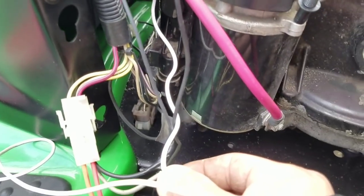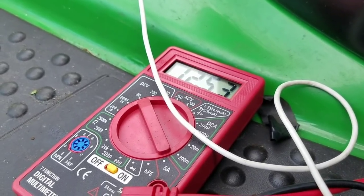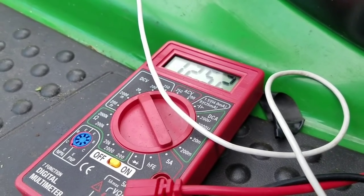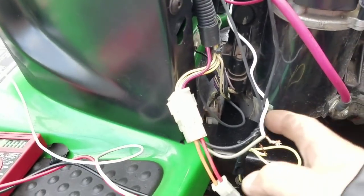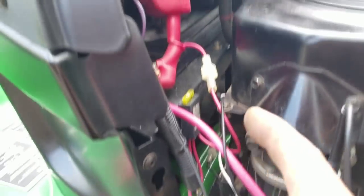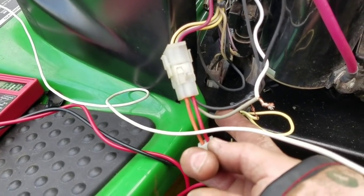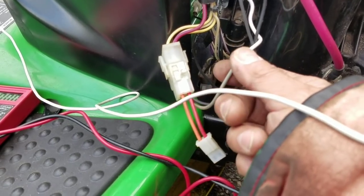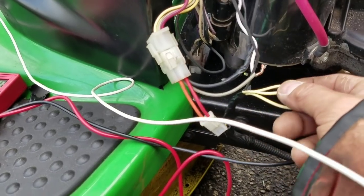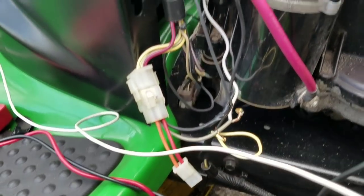Battery is charging. The circuit's got to be grounded - the wire coming directly from the voltage regulator cannot go straight to the battery, it has to be grounded. When you put it to the harness, the harness is already grounded, a good ground. So if this wire goes where it's supposed to be - this leads directly to the battery - it's charging the battery that way. This wire I had connected was to the lights - this is the output to the lights. So it was the wiring that was wrong.